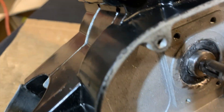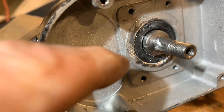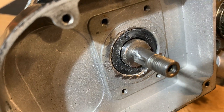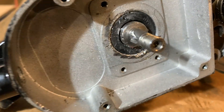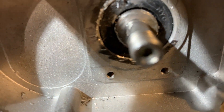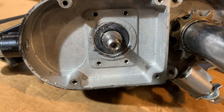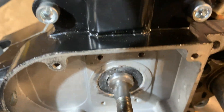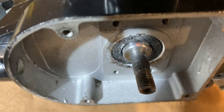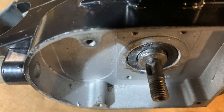The magnet coming apart twisted the crankshaft when it got wedged in there, and stopped it so hard and abruptly that it mis-shaped the actual steel of the crankshaft output and where the keyway rides. Let me rotate this motor with one hand — I put the gear and nut on it just to do it for a quick visual. Watch how bent that crankshaft is. It is really bent.